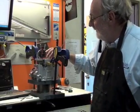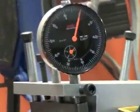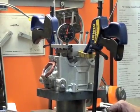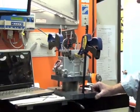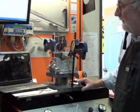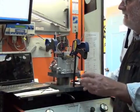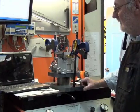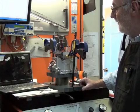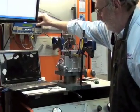We've got the head attached to the flow bench, our fixture set, and we're at zero with both valves closed. This is a Superflow flow bench and we use a Flowcom for monitoring the air flows. We use 25 inches of test pressure, which is computer controlled so that it will always be set at 25 inches. Then we just push on the computer here and it records the numbers for air flow at the different lifts from 50 thousandths to 100 thousandths all the way up to 450 thousandths. I'm going to turn the machine on now and we'll get the test going.